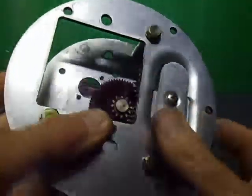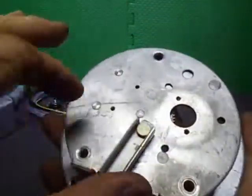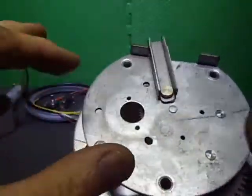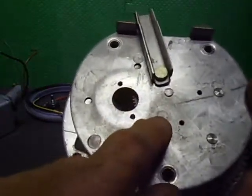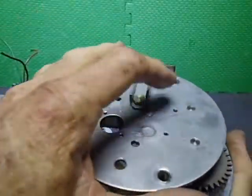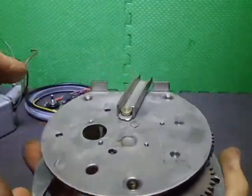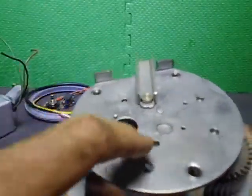Since the original top chassis was rusty as well, I had to take off the drive gear to clean it up because the original stud was rusty and a bit tight. Everything came off and I then fitted and re-drilled a lot of holding points. These blanks have been filled in - these are the original K400 mounting points. I've put in the new points for the 600 or 7600 in a different position. I've also drilled all the holes for the limit switches and a hole through for the wiring.